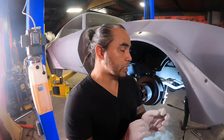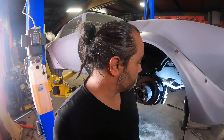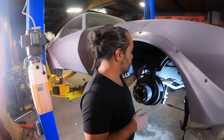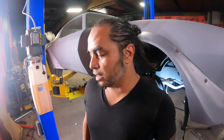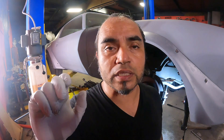I got one side completely clear to put the coilovers on, and now I'm on the other side. I've got the spring compressor in there and it's already tightened up the spring, so it's offloaded. Now I'm taking off the sway bar end links and freeing that up so I can remove the upper ball joint to release the A-arm. The thing about spring compressors — you want to get it as high as you can so it can compress as much as possible. The spring pocket in here is quite deep and the hook caught the inside of the spring pocket.